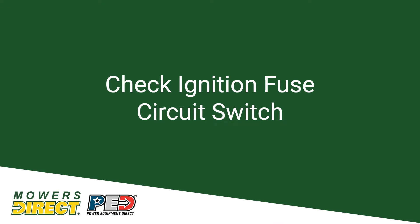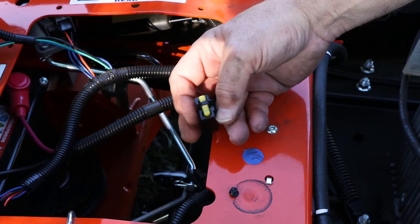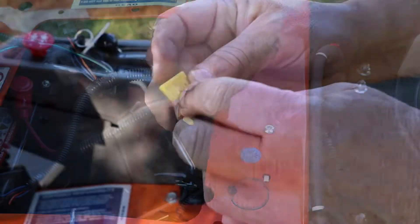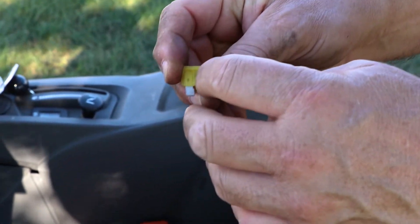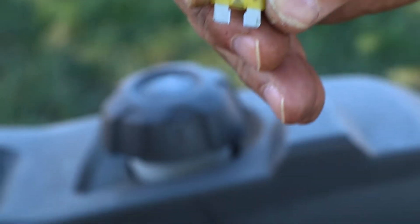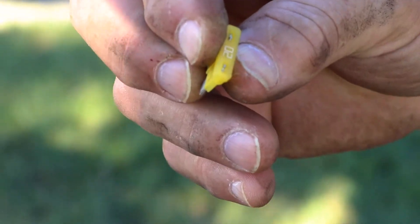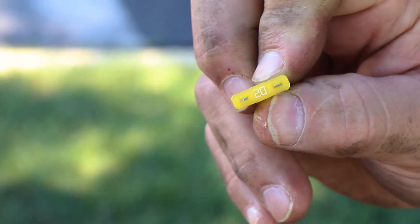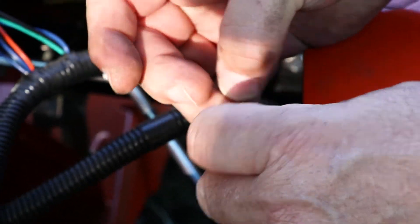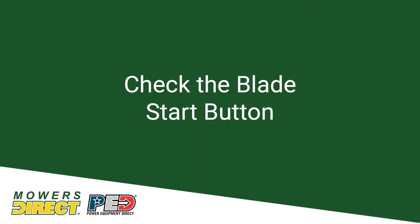There's a fuse here that protects the ignition circuit of the mower. If there should be any jump in voltage, you'll blow this fuse. If the mower doesn't start, this is another thing you can look at. Pop the fuse out and make sure that it's not blown — that the piece of metal is still connected. There's a little piece of metal up inside there; if that's broken, then you know the fuse is blown. You can get these at any automotive store. This one happens to be a 20 amp. Just replace it, push it back in, and put the retaining strap back on. It doesn't really sit in a clip; it just kind of hangs there.